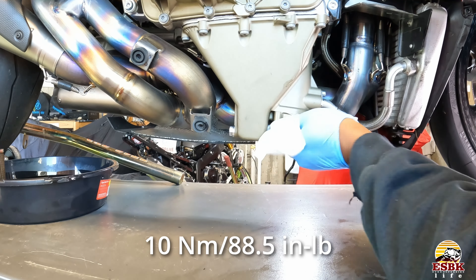All right — oil filter is replaced, drain plug is replaced, we are now ready to put oil in the bike. Let's lower the bike on the table and start to add some oil. So here at my desk: Ducati recommends 15W-50 full synthetic. Depending on which version of your owner's manual you're using — because Ducati likes to update the data in those manuals — the electronic copy on the Ducati website as of this posting says one amount and my physical copy says another. Regardless, I'm going to show you how to best determine where to start.